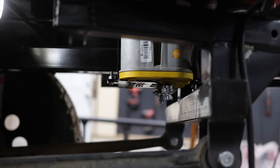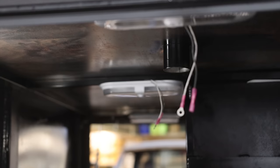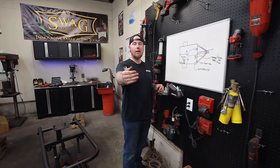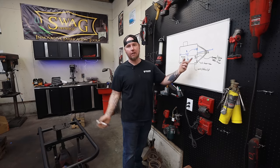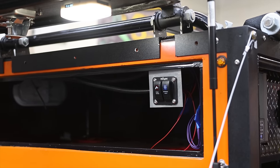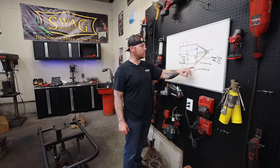The battery gets charged from the DC-to-DC charger and goes to two separate switch panels. The one under the big door controls the air compressor, our interior lights — three interior dome lights in the big space — and a switch for the DC-to-DC charger so I can select between the solar panel or charge coming in from the truck. If we're in a super sunny place like the desert, there's no reason to draw charge off the truck, and vice versa. The two-switch panel in the kitchen area controls our water pump — there'll be a little sprayer over there — plus a kitchen light I installed. In the future I'm also going to add strip lights on the underside of the rooftop tent tied into that same circuit.